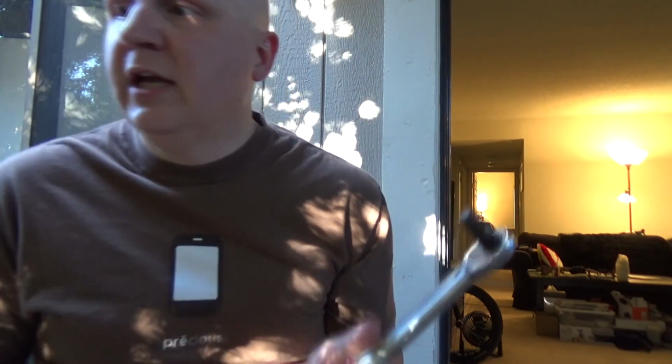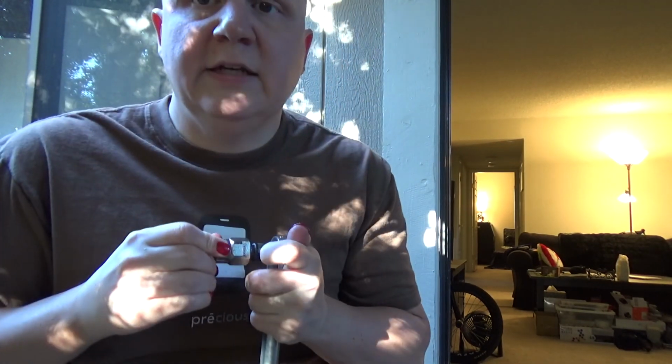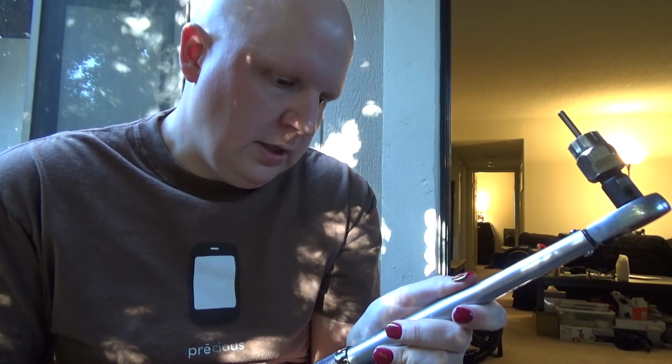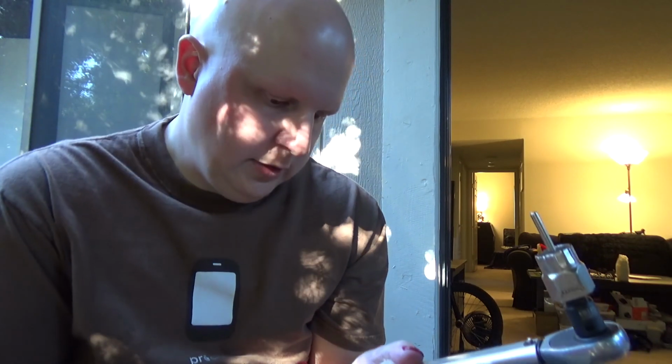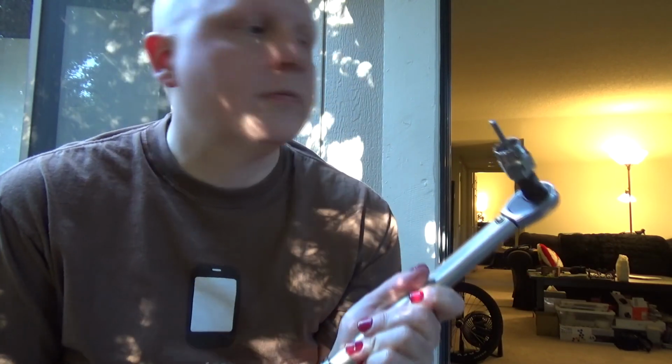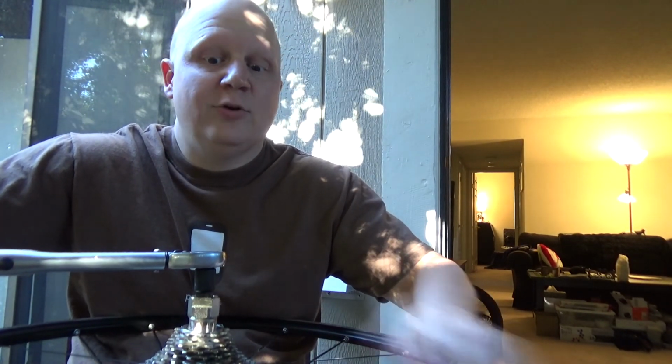Alright, torque wrench, 1/2-inch adapter, which plugs right into the cassette tool. Now this says 40 Newton meters, so not foot-pounds, Newton meters. And there is a line at exactly 40.7 because they made all the notches at foot-pounds. So 40.7, I'm going to go 0.7 over because I'm a madman. Let's do it. So, get that engaged in there. Perfectly torqued.